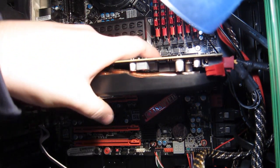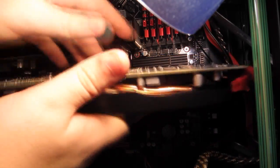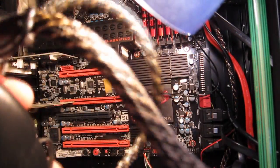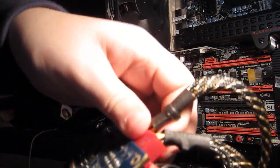I find it easiest to do it with one hand, then have the other hand holding the bottom of the graphics card, and then it just slides right out. Now remember, if you have some of the larger graphics cards, you will have to remove the six-pin connectors from the rear — there are little clips that come right off.